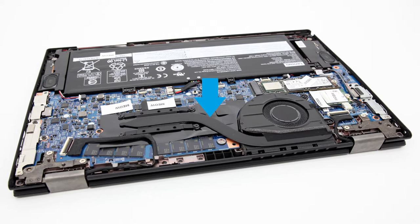As you can see, the fan has a single heat pipe. It's not as impressive as some of the dual heat sink fans. This laptop relies quite heavily on air being taken in from the base cover and then ventilated out. Potentially useful to have switched to a smaller dual fan setup, or maybe a bigger heatsink or additional vent. It's just heat dissipation is not the strongest.